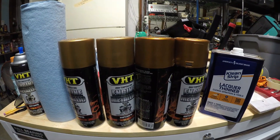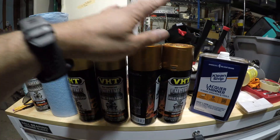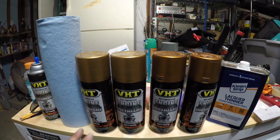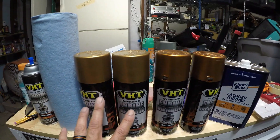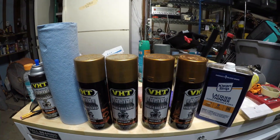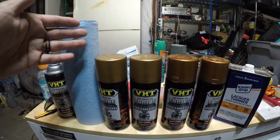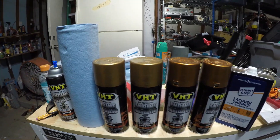Alright guys, there's a small detail I forgot. They only had two cans of the gold flake that I need, and they had two cans of this other color. So I can't wait for another can — I have to do this tonight because I need to mount the wheels tomorrow. What I'm going to do is use these two cans that are a little darker as a base color, and then use the other cans to come over and finish the coat. That way the color is exactly the same and there's no big difference. That's a little painter's trick — if you ever get in a bind, just base coat it with something different, then you can use your original color and you'll use less paint. I didn't want to drive another 30 minutes to get the color I needed, so this is the way I'm going to do it, and I know it'll work because I've done it before.